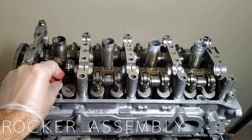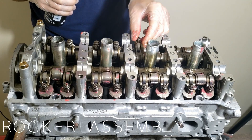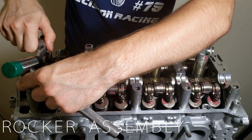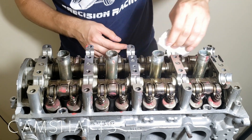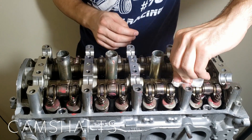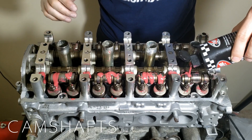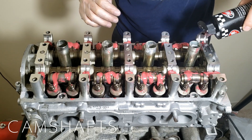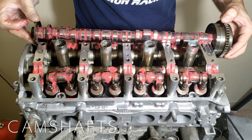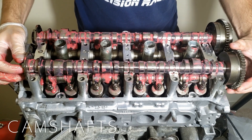After the Honda Bond dries, we can start to add lubrication to the rocker assembly. Remember, we want to avoid metal-on-metal contact so be pretty liberal with it. Before installing the cams, we need to make sure that the bearing surfaces are clean. After cleaning, we can add lubrication to the cam bearings, rocker assembly, and the camshafts themselves. Carefully place the cams aligning the bearing surfaces — if the camshaft isn't sitting quite flat, carefully rotate it until the orientation of the lobes allows for a better fitment.